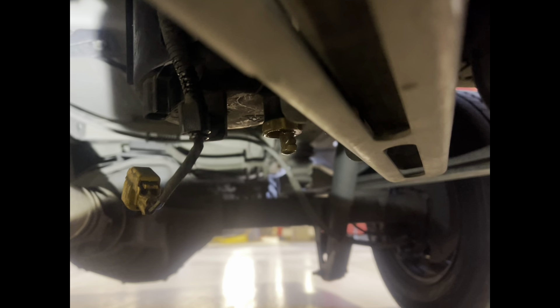What's up everybody, my name is Jonathan, you guys are watching Sonic Speed, and today we're working on a Ford Transit — the DuraTorque, which is basically the diesel. As you can see here, we're changing the fuel filter, already draining it out. You just twist that counterclockwise and it comes out.